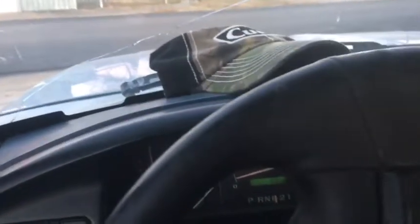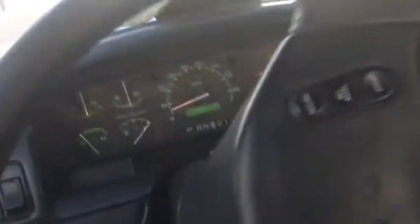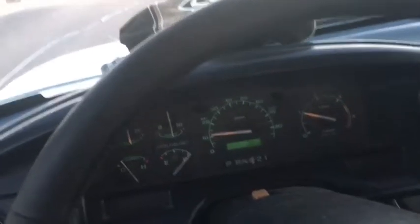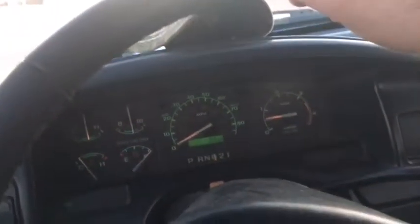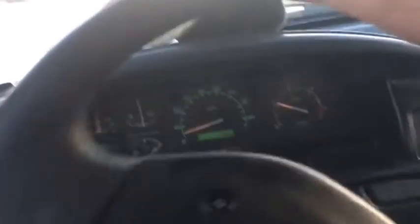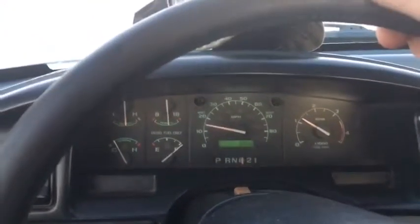Yeah, sounds pretty good. I probably don't need to do that fuel treatment stuff, but I'm kind of curious. The inside of my bowl had a little bit of tarnish in it, whatever you want to call it, so I went ahead and cleaned that out. I didn't wipe out the bottom of the bowl because I wanted to see if there would be a difference with this fuel clean. So, a little experiment. I did have a little bit of gunk in the bottom. It wasn't too bad, but it had a little bit of gravel in it. But where I live, there's a lot of gravel roads, so I'm assuming a little gravel got in there from the road. I have no freaking idea, but it wasn't a whole hell of a lot.